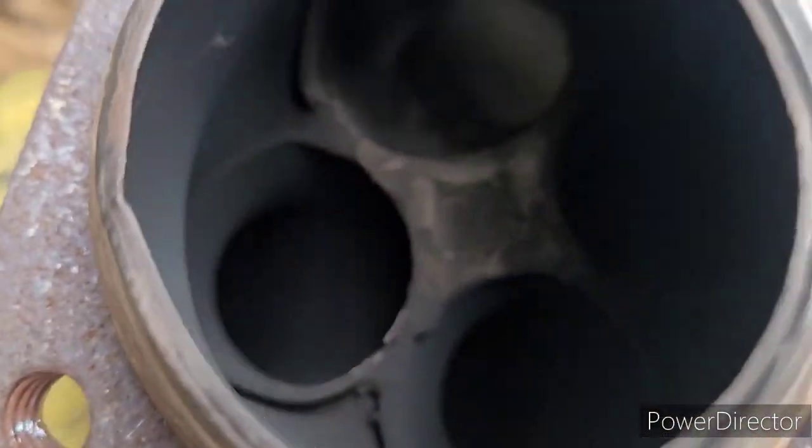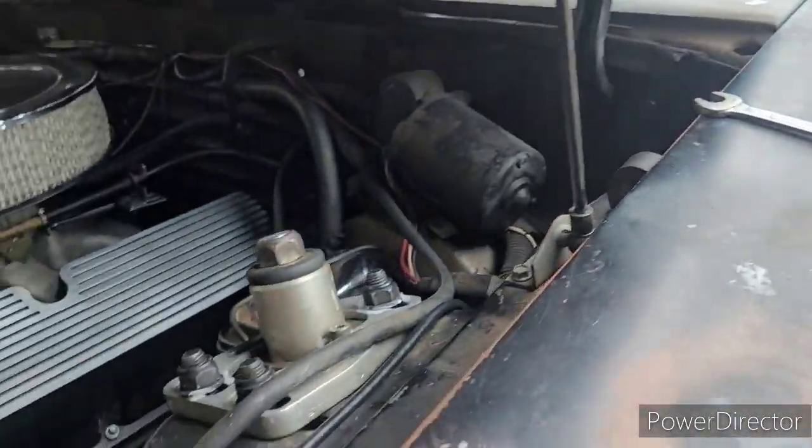I've never been so happy to be wrong. This crack you see, which I really thought from up here was definitely a break in the header that was definitely leaking, appears to be fine. It doesn't go through. I tried flashlights. I tried everything. I tried a light transmission test, and no light passes through it. It just looked like crap. I could have sworn that was our exhaust leak.